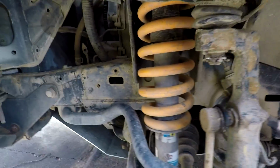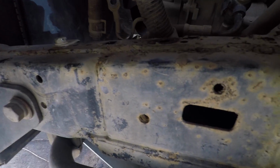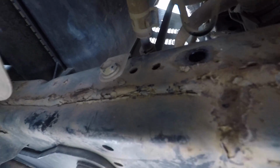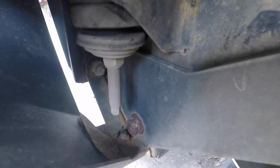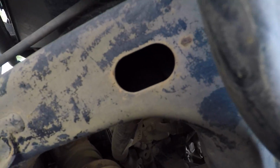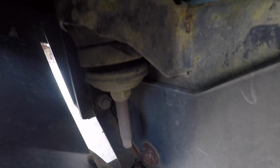Okay, so a quick squeeze, taking out the inner fender lining. You can see the rust that's started in this front section. Also, appears to be not too bad in there. So at this stage, what we'll do is clean up this main chassis rail area all the way to the front and give it a lick of paint.